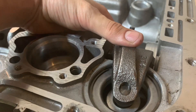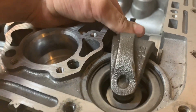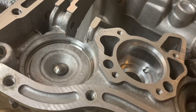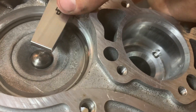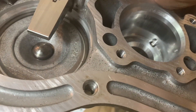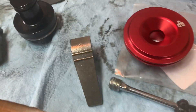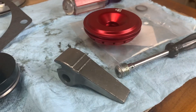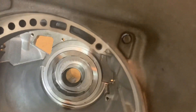With new O-rings installed, I'll just tap that in — new Power Driven Diesel billet fly lever going in. Both levers are on. I'll tap them in and put the plug back over that front pin for the apply lever. That plug needs to be torqued down to 13 foot pounds or 17 newton meters, and it goes right up in there.